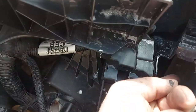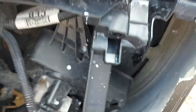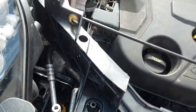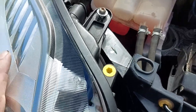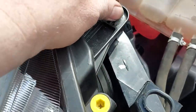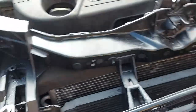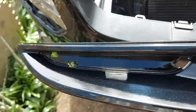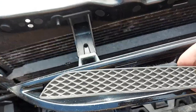So now the bumper is broadly in place. We've got two screws to put in the bumper bracket there, one down there to hold the wheel arch liner in, and then we've plugged in the back of the fog lights. On that side we have a slight problem insofar as I haven't ordered the headlight for that yet - forgot to do that. This side I've just popped the headlight in; it basically clips in with two clips at the bottom, then there's a bolt at the top, and underneath there's this strange eyebrow thing that clips in, and then an inner eyebrow thing that pops in.